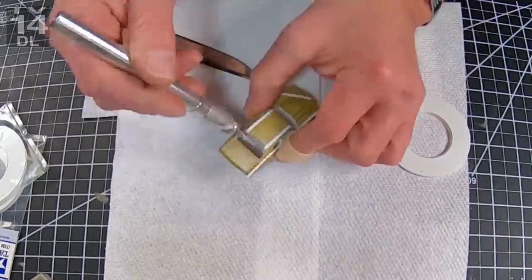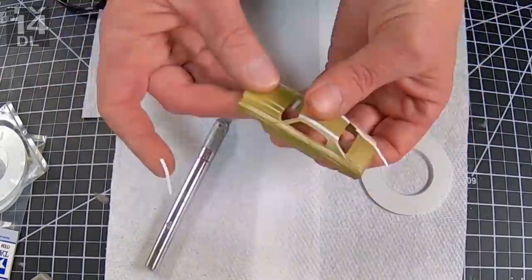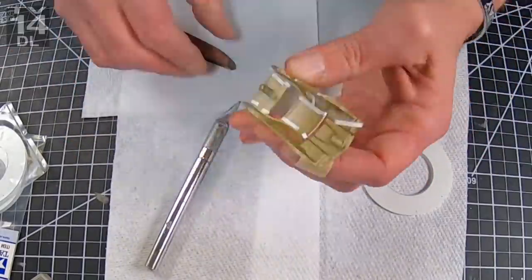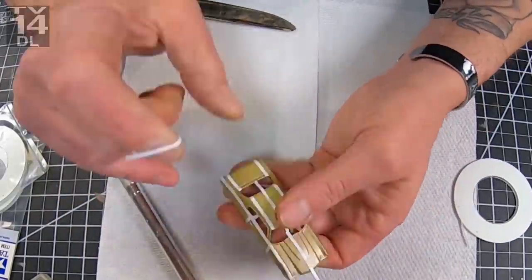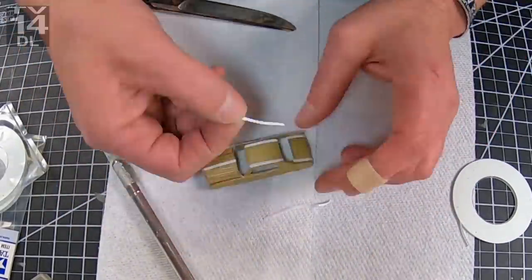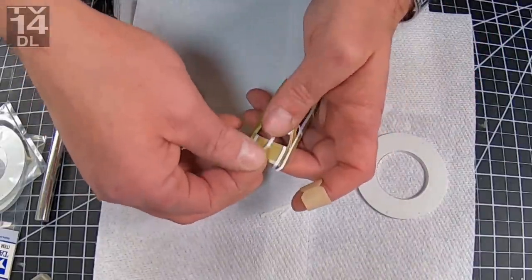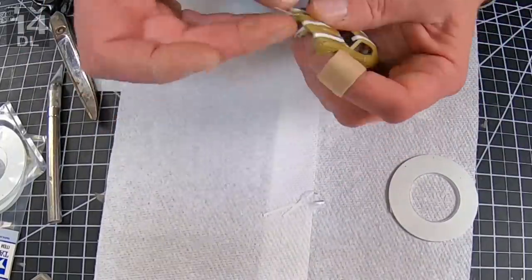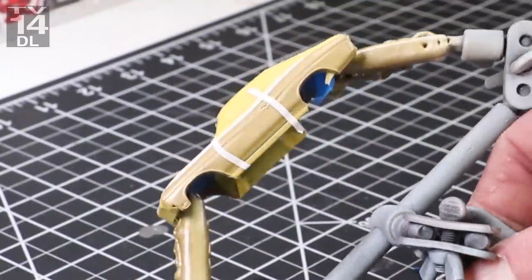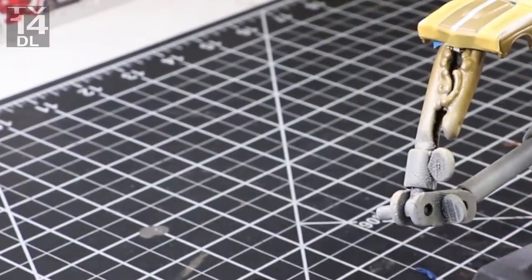The other thing I wanted to do, as I said, I wanted to do panels, but I also wanted to maintain some integrity of the Chevelle and have the racing stripes on it. So you can see there, that's kind of what I'm doing. And it's a little daunting when you start dealing with the masking. If you're going to do any kind of compound curves or anything like that, use this vinyl tape. This stuff is amazing. You can bend that thing around a corner, no problem whatsoever.